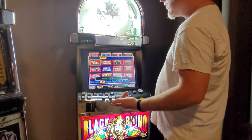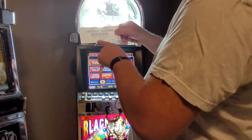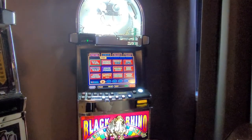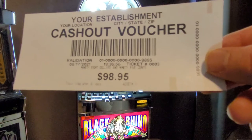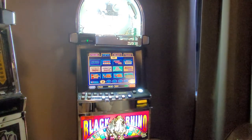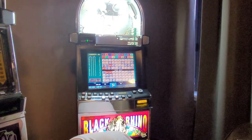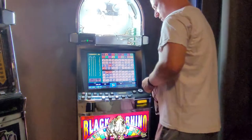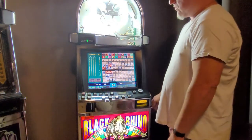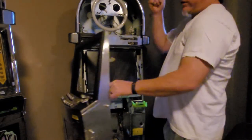Did I do a paper clean? I did. Look at it — it worked! But see, it's faded on the bottom. I'm going to show you what I do to fix that printer. I'm going to take the printer out now. I'm going to see if I fix that bottom fading and some of that lineage in there. I'm going to do it the right way — power it off inside, power it off here, and then the alligator clip into the wire. If you don't have the wire, Murray, you find a different ground — you can use the top of the frame.